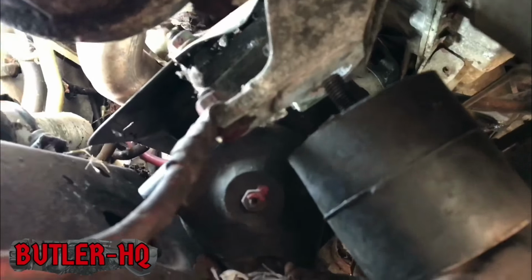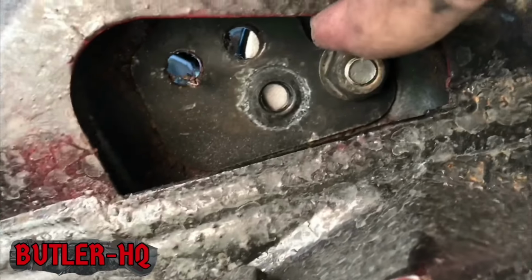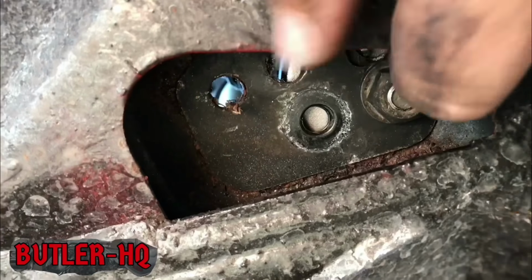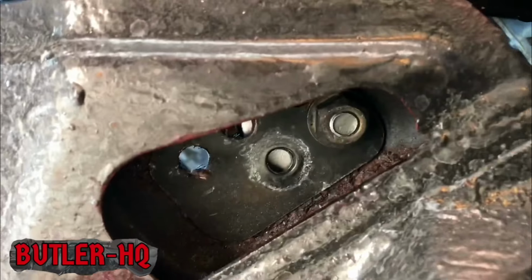Does the 525 engine mount line up? I'm just showing you that it does line up. Look, it goes there, and on this locator here goes the little locator tab, it fits in as well, so you don't need to grind off the locator tab because that fits in the hole nicely. The top also mounts up nicely, so it's a plug and play upgrade, which we like, don't we, Pop?